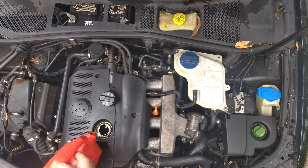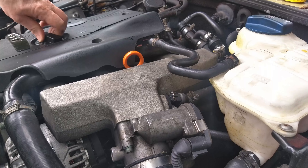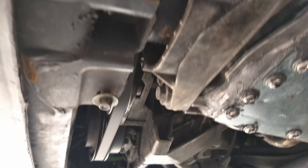I waited 24 hours for the gasket maker to fully set up, then added the oil specified for the vehicle. I checked the dipstick — cleaned it off, gave it another dip — and the oil was full. The moment of truth was starting the car. I let it run for about 20 minutes for warm-up and saw no leaks at all. This worked perfectly. I've actually been driving the car for about four months now, including a trip of about 400 miles back and forth in Florida — no issues whatsoever. It took me about an hour to do. I hope you found this video helpful, thank you for watching.